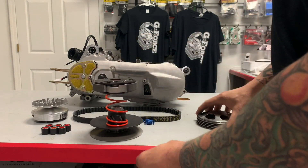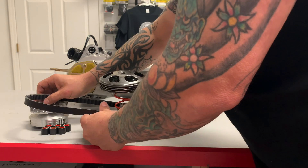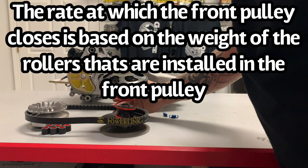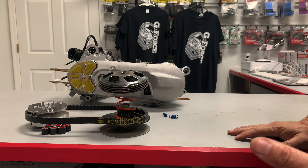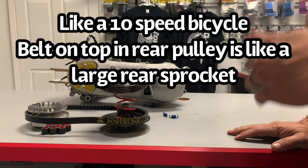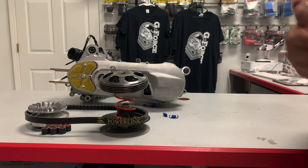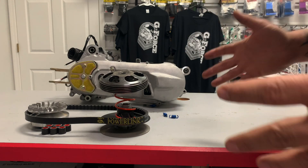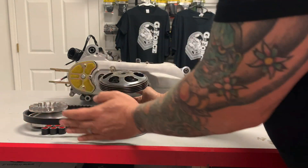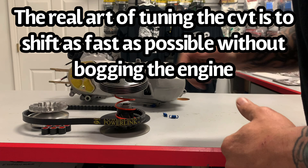With the clutch and bell on, the belt goes around the front pulley. As the motor turns, the belt starts at the top of the rear pulley and goes up on the front pulley. It's very similar to riding a 10-speed bicycle where you start off in first gear — your front sprocket is really small and your back sprocket is really big. Each time you shift, the front sprocket gets bigger and the rear sprocket gets smaller. You're not pedaling any harder but you're going faster. So the motor may not be turning more RPMs, but you're gaining speed because the belt ratio is changing, and every revolution of the motor turns the transmission much faster.